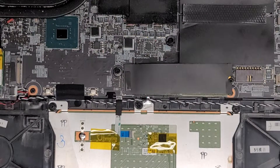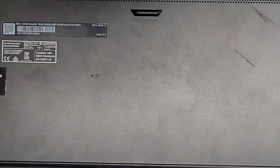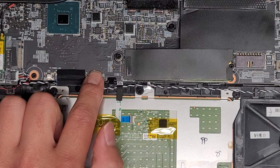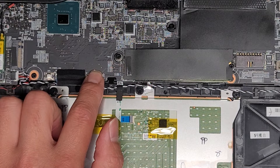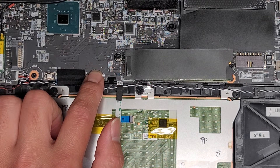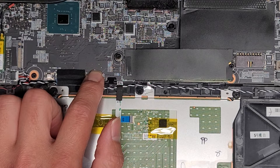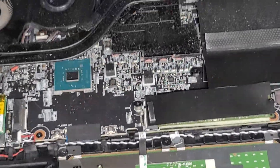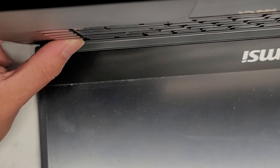Let's see — I'm going to try the battery reset here. Pretty sure it's this one. I'm going to press and hold that for about 15 seconds to drain any residual power. I'll also open it up and hold the regular power button. Let's open the laptop up carefully and hold the power button for 15 seconds to drain any residual power and make it safer to work on.